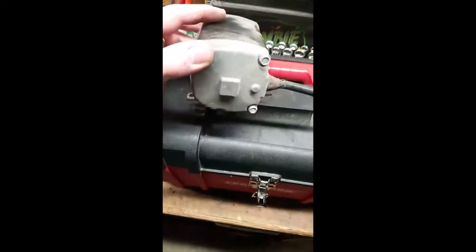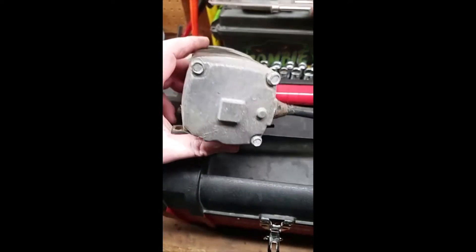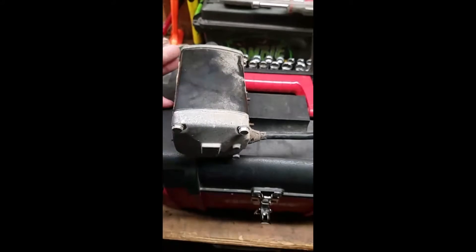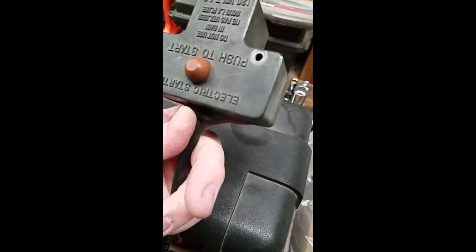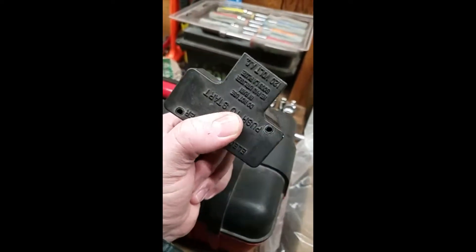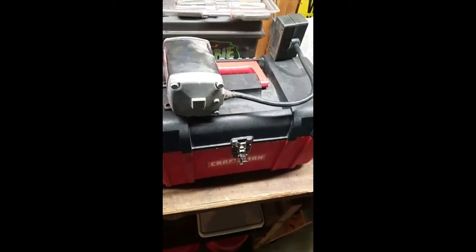What I'll do is open up the end here — there are three screws. I'll open the end and attach a multimeter to see if maybe it's the switch in here that's faulty. Either way, you can't really open this unit. If it is the switch, I'll see if there's a diagram where you can buy just that part for it.